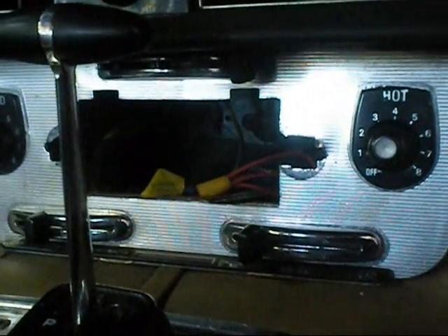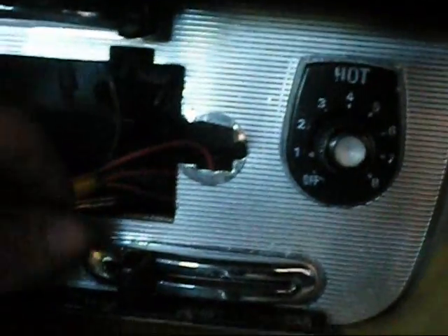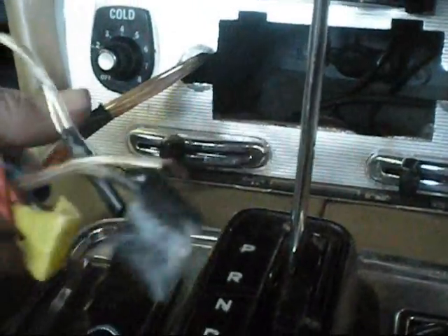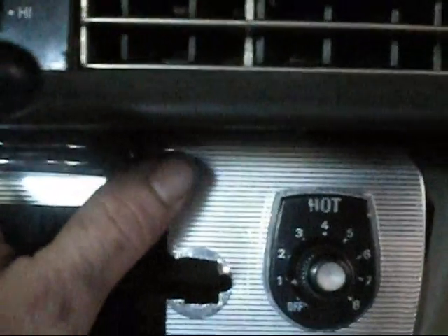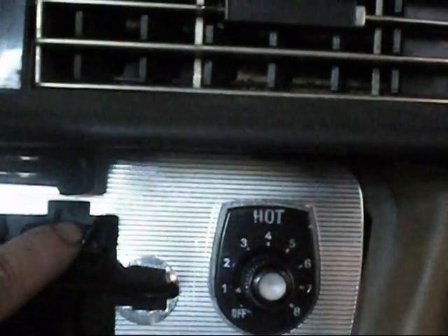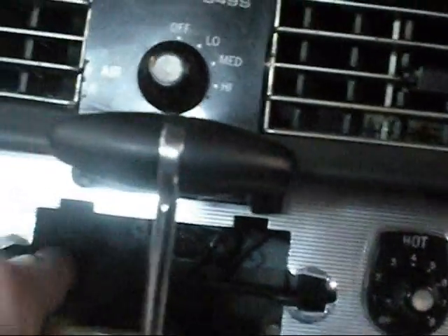If you're wondering about radios — this is where one should go in this car. It's deep enough to put a modern CD player in there, unlike some older cars. I've got a new control tap, that's that vacuum tap back there, so I can get this working. I've got a new face plate as well, so if this has been cut too high for the old 8-track that used to be in here, I can put that in. I've already wired everything up — I've got power, memory and two speaker wires. This knob up the top here is for fresh air on and off. Originally there would be a little thing saying open and closed here but someone's cut that out — I have got the little tabs that go in.